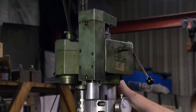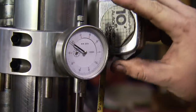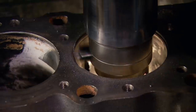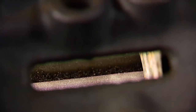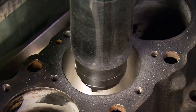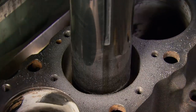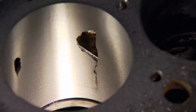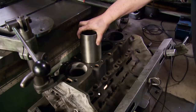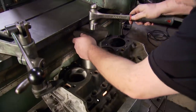Before any metal is carved out, the boring machine is set within thousandths of an inch of what's needed for the sleeve to fit. Boring it out takes several passes, shaving a tiny amount of metal each time. Any single part of the process can make or break your engine, so be sure to deal with somebody that's got a good track record. The wall isn't bored all the way into the crankcase — there's a little bit of a lip left for the sleeve to rest on.